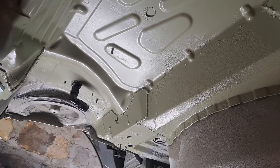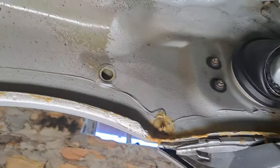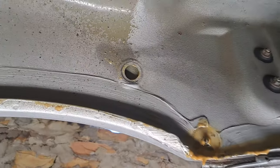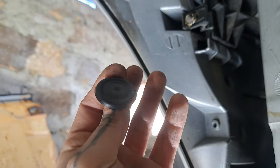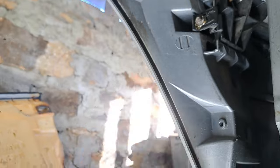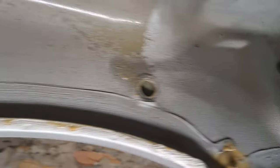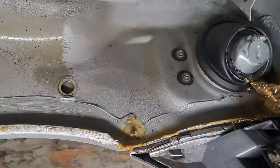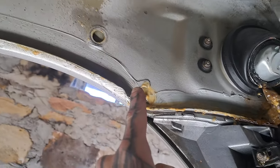We're now below my primary project car. I'm going to show you those plugs which you can remove to apply your cavity wax. We're going to attack this wheel liner first — we're going to remove this wheel liner to get us access in here as well. But for now, we're going to pop these three plugs out here, here, and here. The plugs appear like this. If you end up breaking or tearing them, you can still buy them brand new from BMW and I'll link them in the description. You're going to pop those plugs out and then apply your cavity wax, spraying it through every hole, trying to really fill in that void between those two pieces of metal. I really wanted my wax to begin flowing down here, so I sprayed a lot in here so it would just flow and fill in this whole cavity.